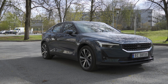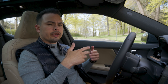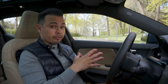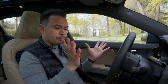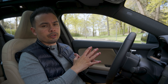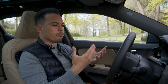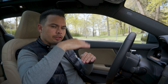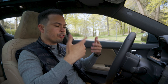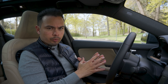Even though these are built in China, this is basically a Scandinavian vehicle, meaning that it has to perform well in winter and in snow. And if you don't know, front-wheel drive cars have much better traction in the snow than rear-wheel drive cars — traction in accelerating and moving forward. Braking and cornering is pretty much the same, but getting forward traction in the snow is much better with a front-wheel drive car. Usually this is because of the engine that sits on top of the drive wheels — you have much more weight over the wheels.